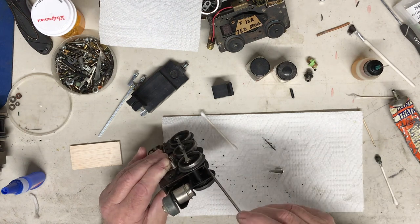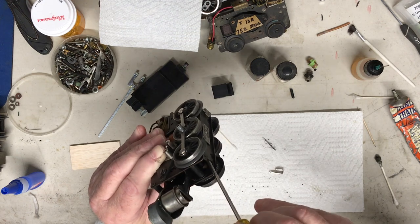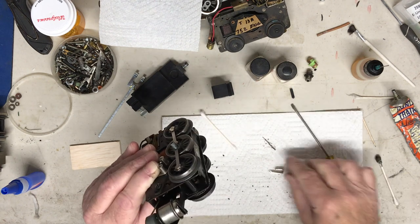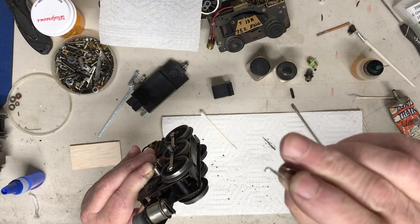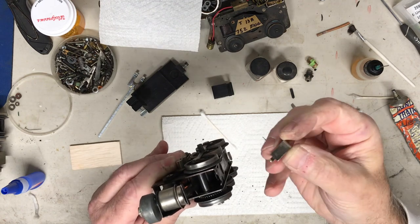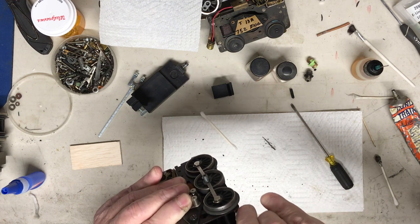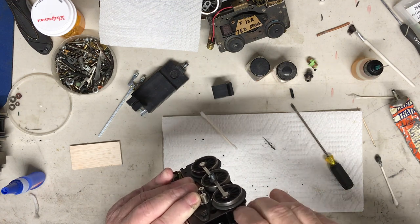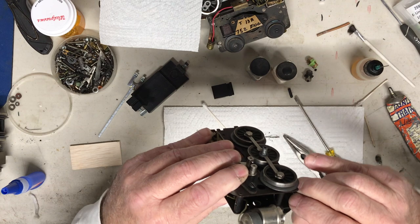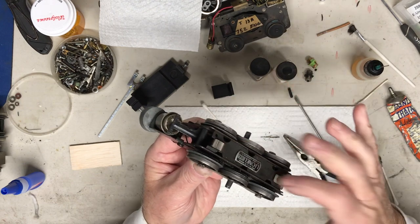Like I say, this little copper, spring-loaded piece of copper has a square hole in it. Just right behind it has a little square hole for this. This slide shoe goes up in there, goes under the copper plate, and this little tab goes up through that square hole. So it's not really that difficult to get one in. You just got to get it underneath there. I'm going to try that again. I can feel better with my fingers. There, see, it clicks. That wasn't too bad.